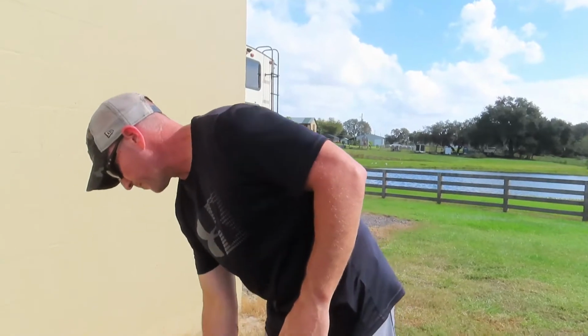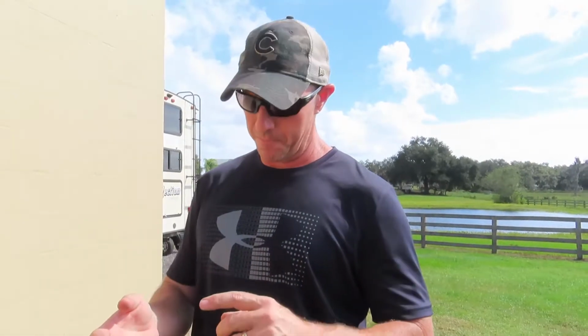So if you're wanting to install some batteries in a location where you either don't want to worry about checking the water, or you can't access them to check the water, AGM is going to be the way to go. The benefit of an AGM battery, you're going to get a higher capacity. They typically have more reserve capacity than a standard wet battery will, and they're also going to last longer. They're going to give you more longevity.